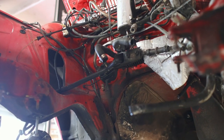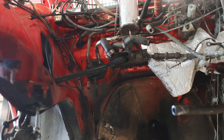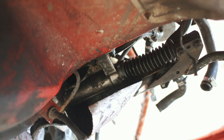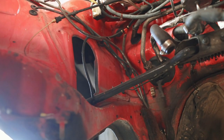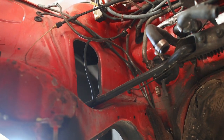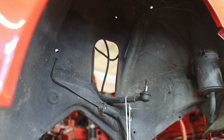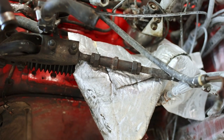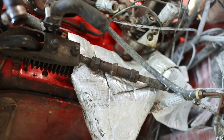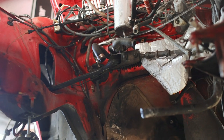I don't know what Audi was thinking when they designed the steering rack setup for this car. The steering rack in the Quattro is actually mounted behind the engine and above the transmission. I know this is the result of odd packaging constraints due to the drivetrain in this thing, but it's still weird — really weird. Frankly, it's also the biggest reason we're not going to put some other foreign power plant into this car; it would be a complete headache. The tie rods extend from the center of the car through the fender liners and out into the wheel wells themselves. The hole through which they pass is tall so that the suspension can still cycle, and the toe is only adjusted on one side. Overall, it makes sense and I understand why they did it, but it's still unlike any other car I've seen personally.